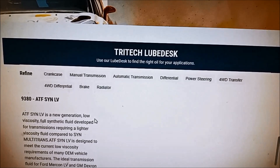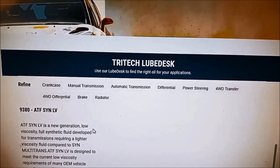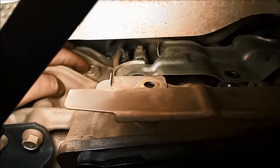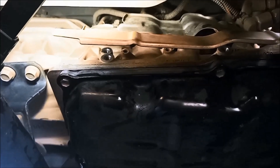You can use any brand of compatible transmission fluid — you don't always have to use the genuine stuff or the dealership oil. To fill it, there's a plug on the side here where my finger is, 24mm. We've only drained the oil and it looks pretty clean, so we're not going to suck any extra fluid out of it. About five litres will go in, and then we need to get it up between 40 and 50 degrees.